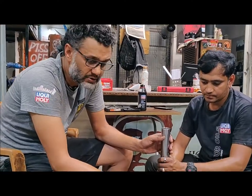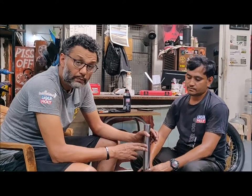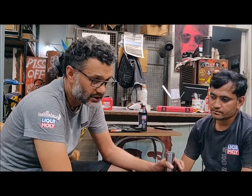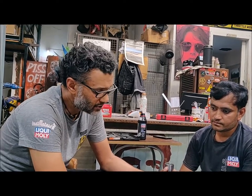What we're going to do now is very simple. Most manuals and most people in India tend to look at the quantity of oil, but my theory is that we look at air gap. Air gap is the amount of air measured after you pour in the oil, but without any other components installed in the fork — so the springs, the cartridge — you take them all out, pour the oil in, and measure what's called the air gap.